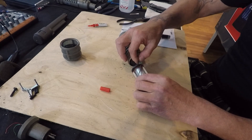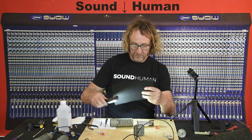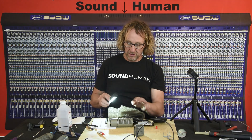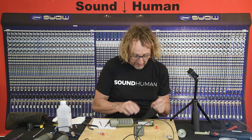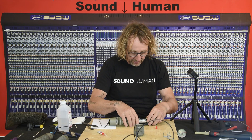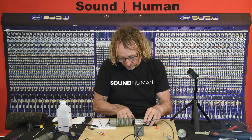We can pull these wires out a bit and get them nice and clean. I've got two types of foam here — these are speaker grill foams. One has a soft, finer mesh, and this other foam has a much coarser mesh. I don't think it's that critical for the rebuild; it's going to be better than the rotting foam, and they've changed the foam types over the years. Just getting something close is going to be good enough. Definitely use open cell foam — foam that you can breathe through. You do not want closed cell foam, because that will alter the sound negatively.